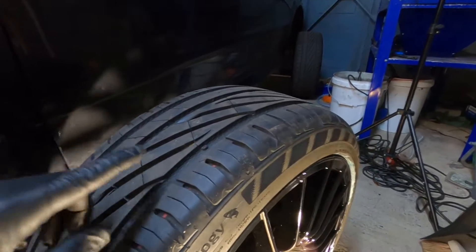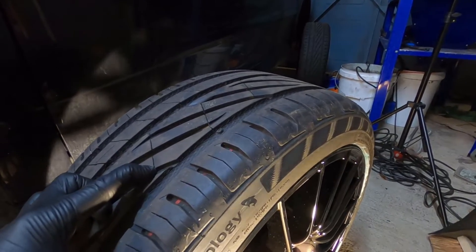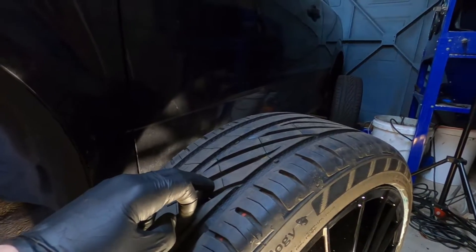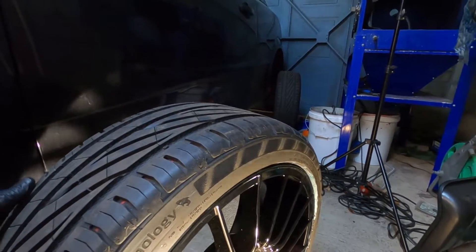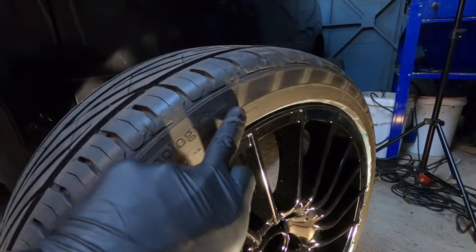One of the top things you can do is check the tires. If your tires are quite old — five years plus — that's the first thing to check or replace. Even if the tread is still good, the sidewalls can get cracking. The difference it makes is night and day.